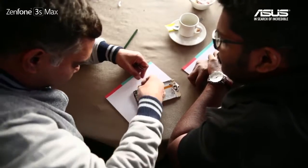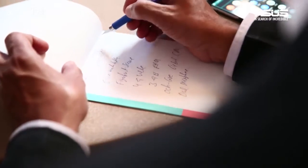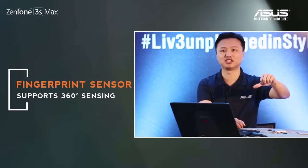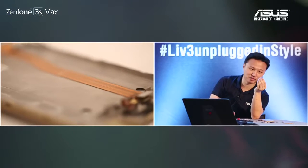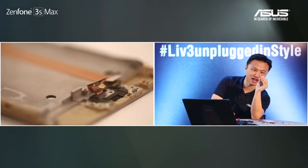Let's do the last part — take out the sub-motherboard. Under it is the fingerprint sensor, which supports 360-degree recognition. You can take it out and see that there's a button. By the way, since I'm taking it out — the proximity sensor is also here. Your phone can support a premium sleek metal body with this design.